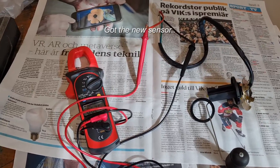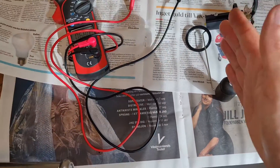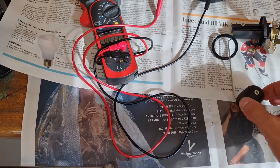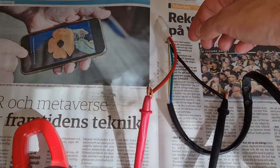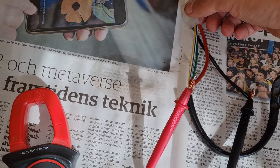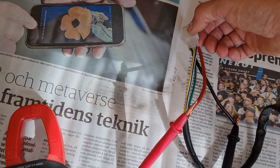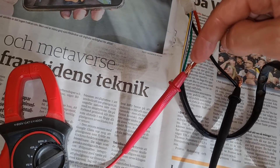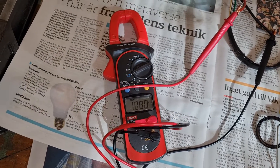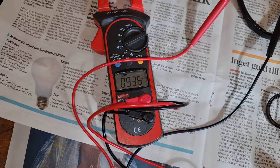Time to measure the level properly. I put the arm in the full tank position - you know, where it floats up. I connected one wire to the blue-white terminal and the other to the green outlet. I've connected a couple of cables and then connected them to the multimeter to get a good connection. You can see it fluctuates somewhat - the resistance is not very stable.